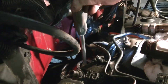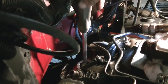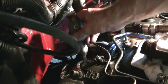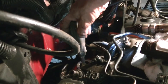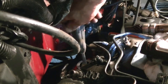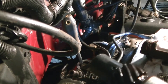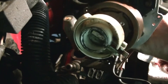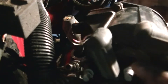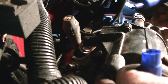Since I can't see in that hole, I'm going to play it by ear. Once I find it, I'll try and see which direction it's facing. I'm on it now — I just have to find which way it's turned. You'll be able to feel it when you can feel it sitting on top and it turns. Now here's the tricky part: you can pretty much put the distributor anywhere you want. You can put number one anywhere on the distributor to have the back of the distributor turned in the right direction. I'll just put my cap on loosely and I want this one to be my number one.